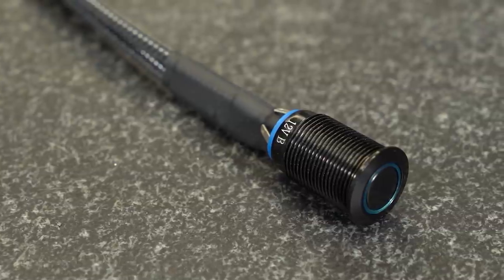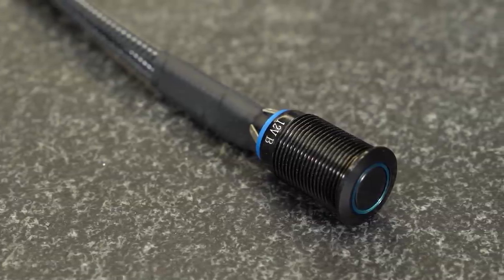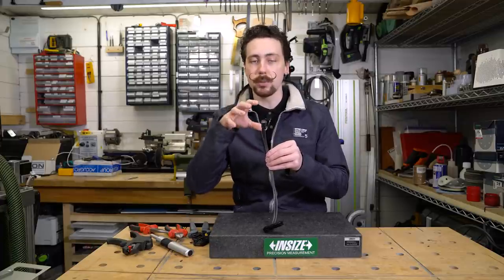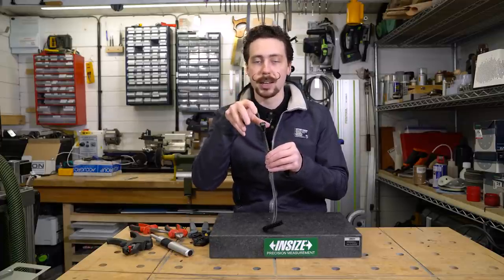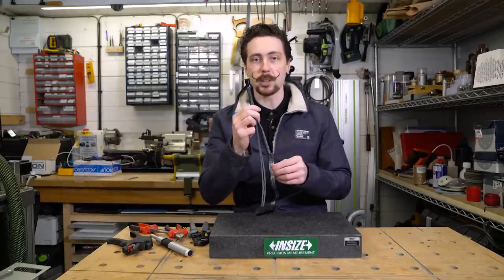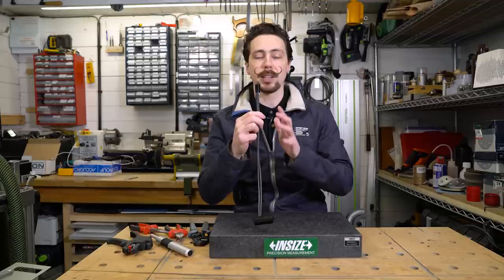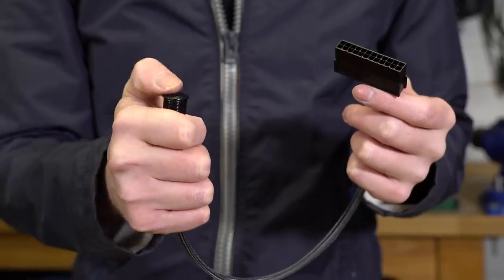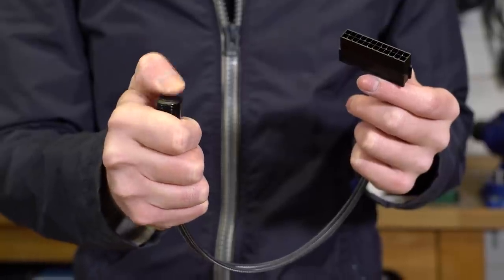It's just really important that you use a latching switch for this, because if you use a momentary one, it's just going to close the circuit for a short second as you press it, and then it's just going to go back to normal and switch the whole PC off again. What you want to do is make sure that this thing is providing a closed circuit for as long as you want it, and then you can unlatch it again when you're done. And that's all there is to it.